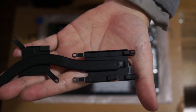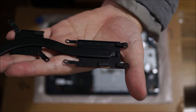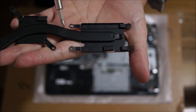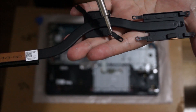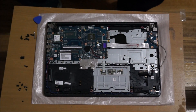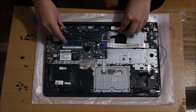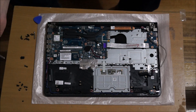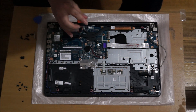Here's the heatsink — I'm going to show you the numbers on it. If you have it in front of you, you'll be able to see the numbers. There's number one, two, three, four, five, six. Just realign your heatsink on top of the thermal paste — try not to press down yet, align it with the screw holes first. Then screw in the screws according to the numbers so the thermal paste gets spread out evenly.